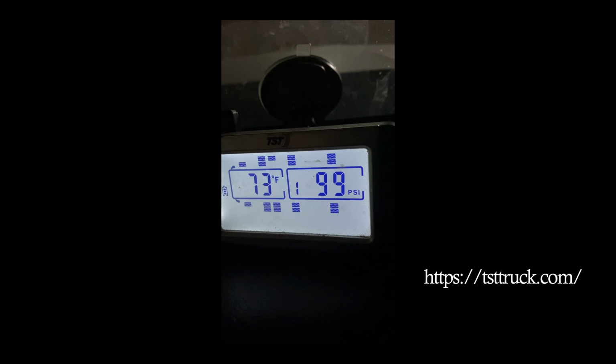They're based in North Georgia. And this whole system will probably run you about, geez, I forget how much I paid, probably about $500 to $800. Sounds like a lot of money, but this is going to save you so much time, and it's going to save you money on tires in the long run. Even just catching one slow leak before you blow a tire, you just save $300 to $500 on a tire. Or if you catch your steer tires, if there are two tires that are not the same pressure, over 5 pounds difference, and you catch it before it makes an irregular wear, that's another tire that you just saved. And if you're buying Michelin, just a $500 tire you just saved.